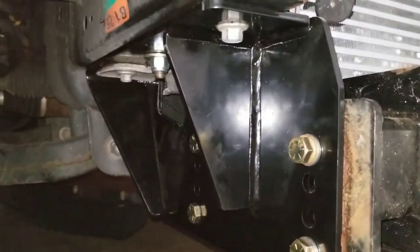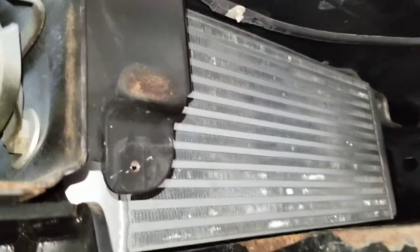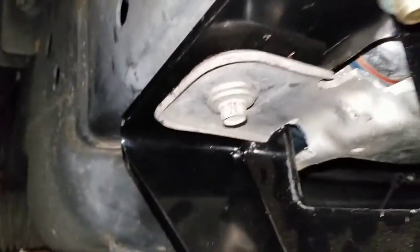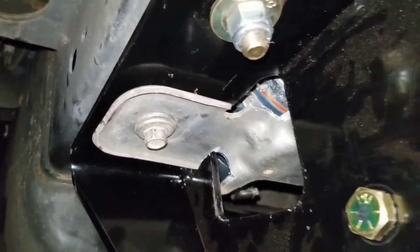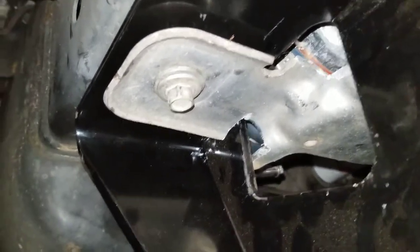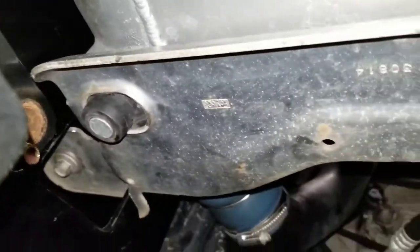Here's my push plate — they call it a weldment — and at the bottom here's my cross member right in the middle. You have to take the grille off the truck and take the front bumper off. I have an aftermarket CV fabrication intercooler. The weldments on the left and right side of the truck — the bottom radiator intercooler support — have to be notched and trimmed to go around the push plate.